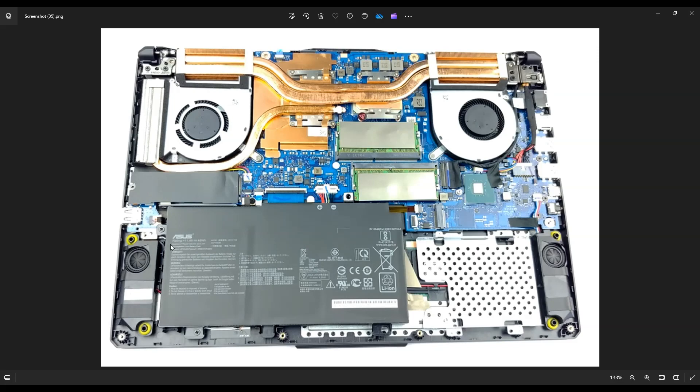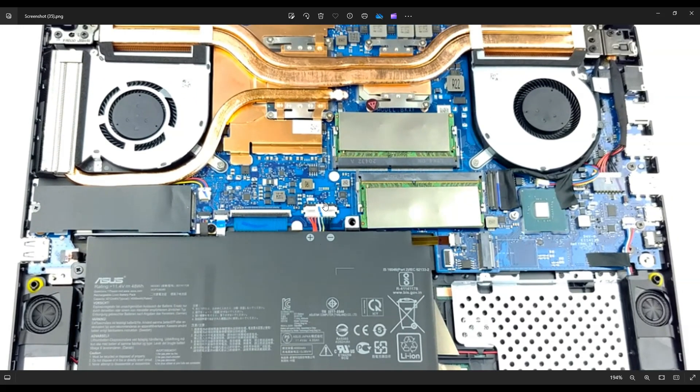You've got a screw here on the left of your battery, a screw down here on the right, and it's plugged in right here. So undo those two screws, and then right here you have your battery port. There's another sticker here — they love their warranty stickers in this model. There's one here that will break when you take this port off. So don't just pick up the battery and yank on it. Some of these wires can come right out of that plug. Put your fingernails or a small plastic pry tool on either side and just slide this straight down toward the bottom of the computer, and that battery will release.